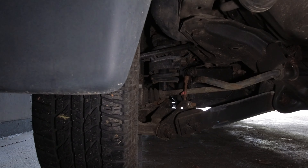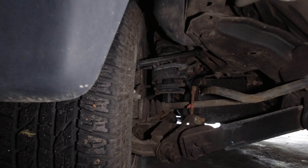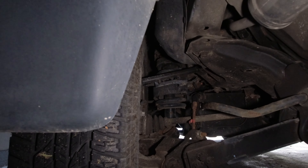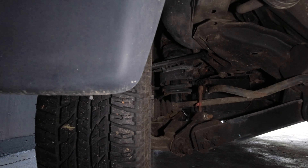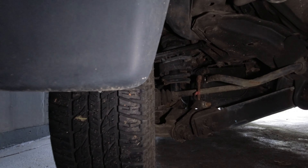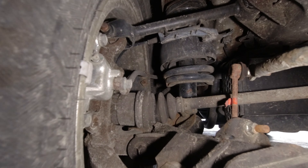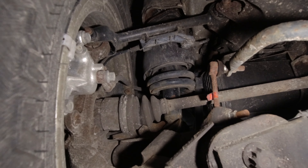In the rear we have a one and a half inch lift kit from eBay — if you recall from my previous video I was talking about my lift. I do have an additional spring assist on the rear here. You can see it — it's a rubber piece that you wrap around the coil to reduce the sag when it's fully loaded.